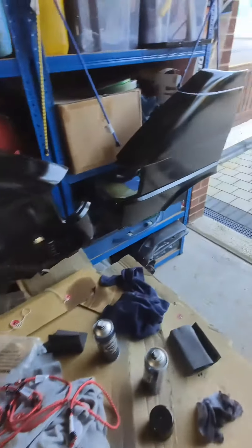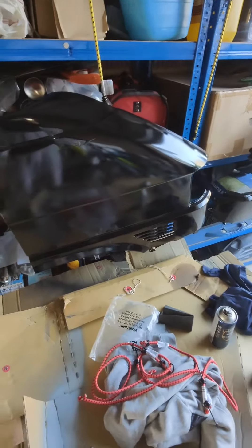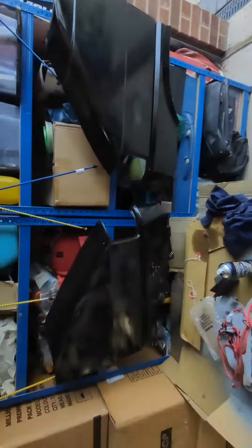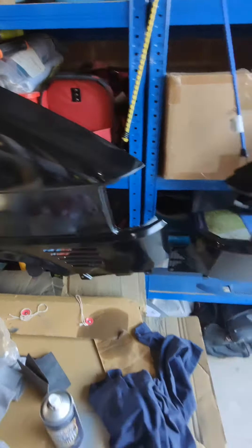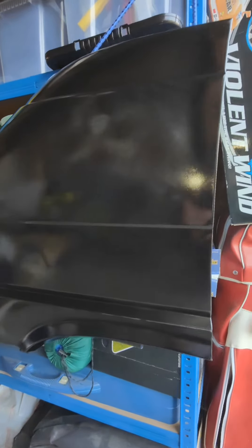Right, I've painted the two wings hanging on the bungee cords there on the racking. Trial and error — what I've noticed is I've tried to lay this on a bit thick, and you can see there's a run there. I'll wait for that to dry and rub it down. It's going to need multiple coats. The left hand side panel has been put on sort of thick and quick, a bit close maybe with the spray. The right hand side I've deliberately given a lighter dusting, so yes it looks patchy.